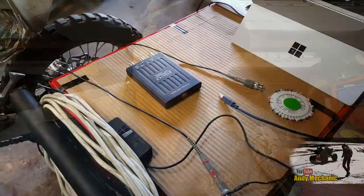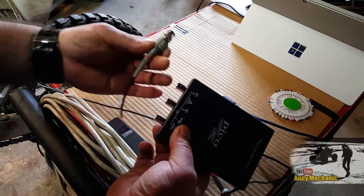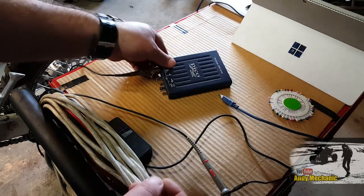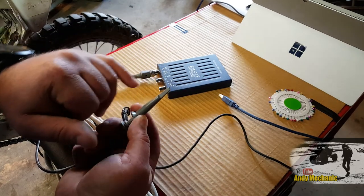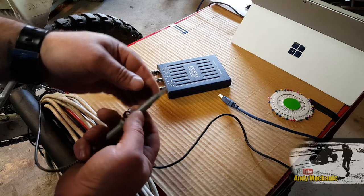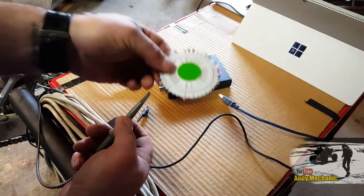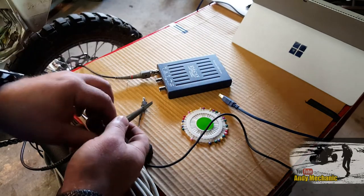Short video - don't forget, Andy. I'm going to head over to the bike, show you which wire is the signal wire for the crank angle sensor, show you how to back probe that wire, and then we'll set up the PicoScope with the correct settings to get a decent waveform. We're going to use a single channel - channel A for this test - and plug in one of the little probes. That's your earth lead, and they come with a little adapter so you can clip onto a back probe or onto a wire. We're going to use these little pins, which are like two dollars for three. You've got to ignore the colours, but they're really useful.